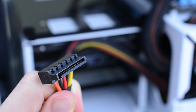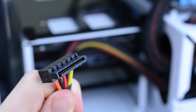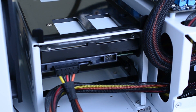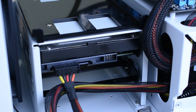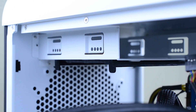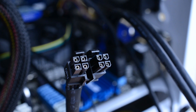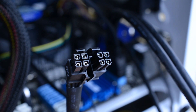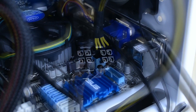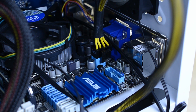Next up find the cable with the long flat ends — these are SATA, which are what you'll use to power hard drives and optical drives. Thanks to the little notch these will only go in one way. Attach one to the hard drive; it doesn't click so make sure you get it inserted fully. This is the same process if you wanted to use an optical drive in a five-and-a-quarter-inch bay. Grab the CPU power connector we ran through earlier and break it apart, as this motherboard only needs four pins instead of the full eight. Click it into place and you've got the CPU powered and ready to go.